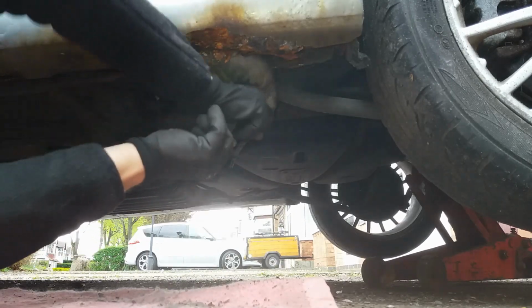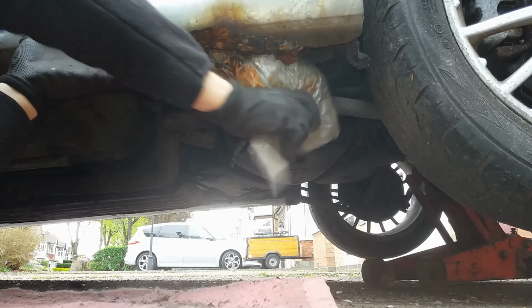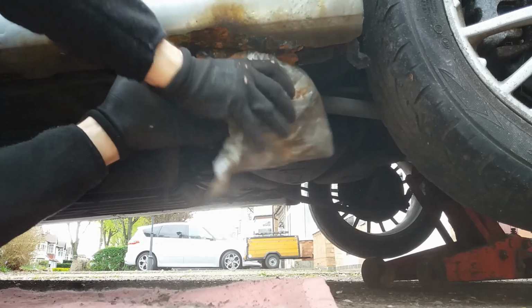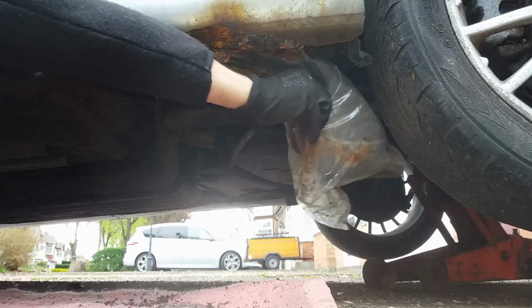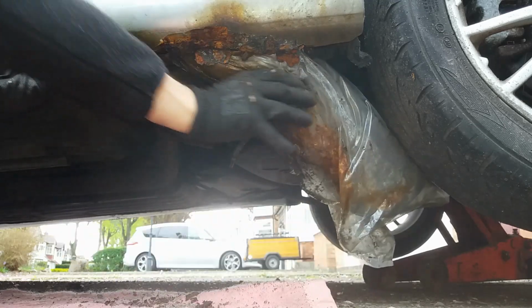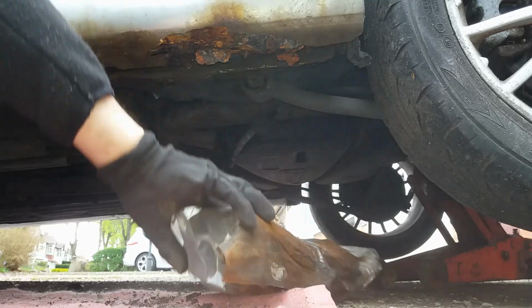If you're wondering why, when you took your Alfa Romeo GT for its annual technical inspection, it failed miserably on the fact that the sills were hanging off and red rusty, this is the reason why. Alfa Romeo put these soundproofing bags filled with a sponge inside the sills, and they're basically rotted from the inside out.